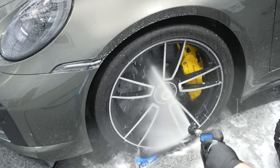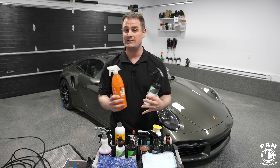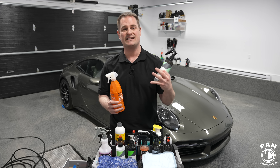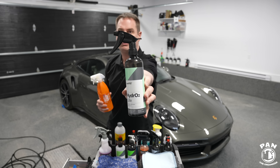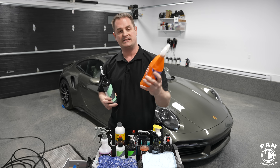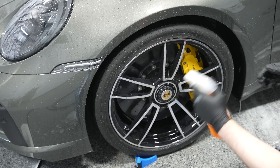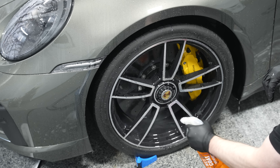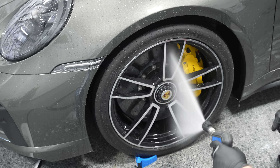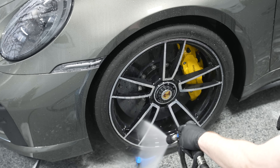To help with protection and to quickly top off if they're ceramic coated — or if you've never had protection on your wheels and want them easier to clean during maintenance washes — add a spray-and-rinse sealant that's silica infused, using ceramic technology. Something like CarPro Hydro2 Lite, the pre-diluted ready-to-use version, or Gyeon Wet Coat. Both are spray and rinse: once you're done cleaning your wheel and tire, rinse it off while still wet, spray a few spritzes directly on the wheel, and immediately rinse off with a high-powered jet from your pressure washer or garden hose. Your wheels are protected, beading and sheeting water, and easy to maintain.